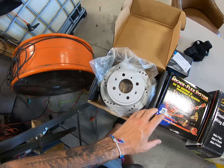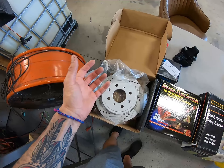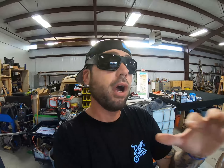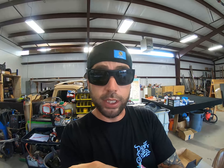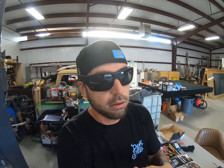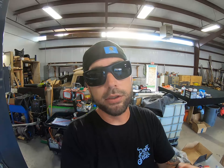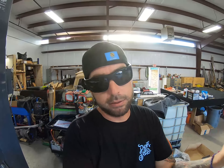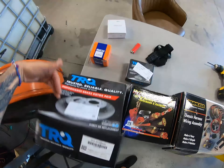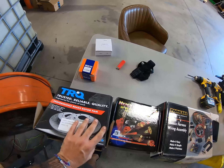It's for the rear hub. There's a plate that goes on and I'm still waiting on that to come in. There's a plate that just bolts on. Then what I do personally is use the front caliper and stick it in the rear. I ordered a big brake kit for the front, so besides buying another set of calipers, I just stick the front ones in the rear and use the new ones that come with the big brake kit. That's the easiest way I found to do it. Here's the rear discs and here are the pads for that rear disc. I'll probably go with something a little more upgraded.